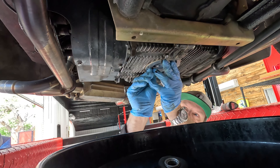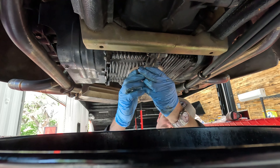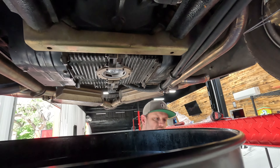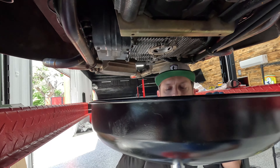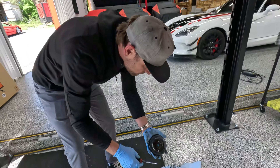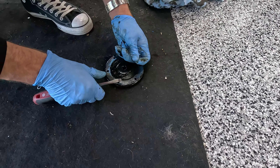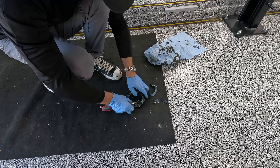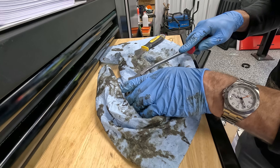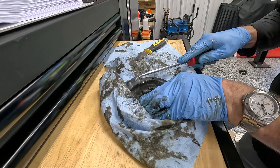Is there a specific orientation? I don't think so. I think as long as that spout goes in the center, we're good. The filter is just basically for large particulate and that's it. Remove the old gasket. That's going to suck — you have to scrape that. First hard thing about this oil change. I feel like these cars are designed so that it's just going to leak. A paper gasket — it'll hold for a little bit, but it's definitely going to leak at some point.